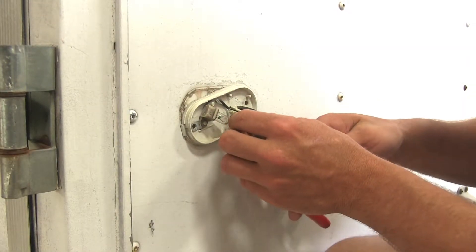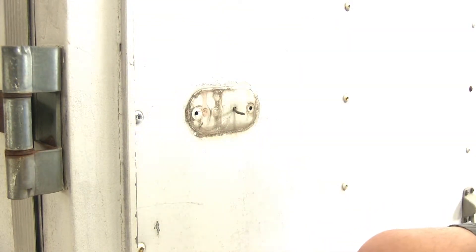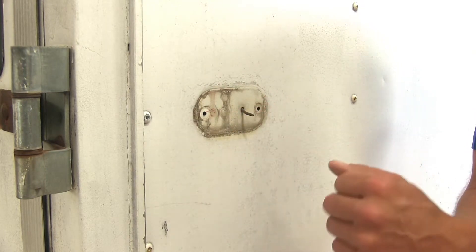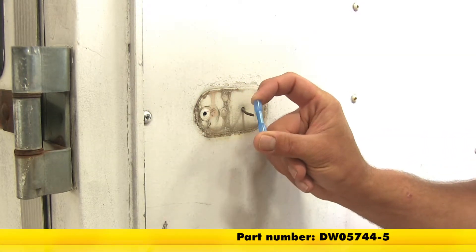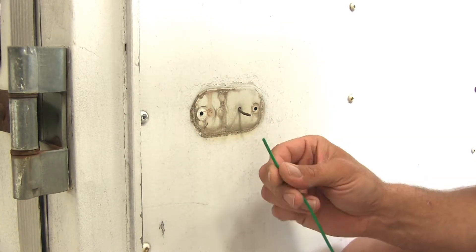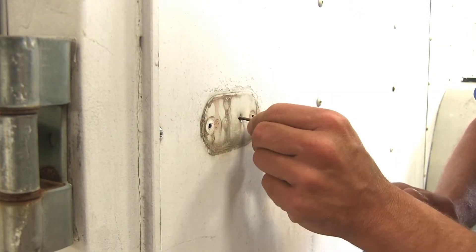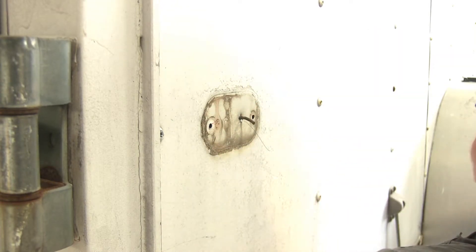You're likely to have a wire attached, so just trim that and get the old light out of the way. As you can see with our wire, we don't have a whole lot of slack — when you do light replacements you're going to run into that quite often, so we need to get this extended. We're going to use a heat shrink butt connector, part number DW05744, and also a short length of wire. 16-gauge will be what typical trailer wiring is. You can get that on our website as part number 16-1-1. Depending on your application, you may have to open your hole up a little; ours had a pretty narrow hole so we're going to expand that so the butt connector can slide through.